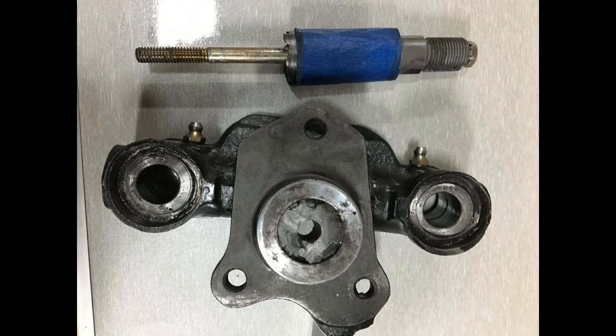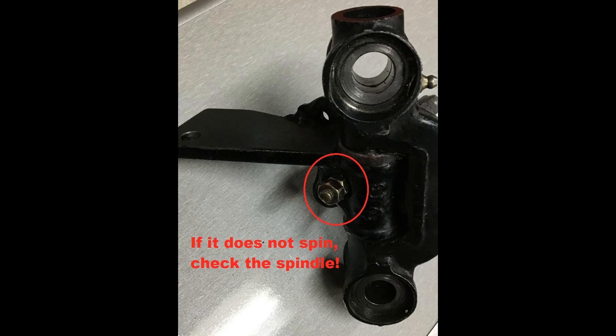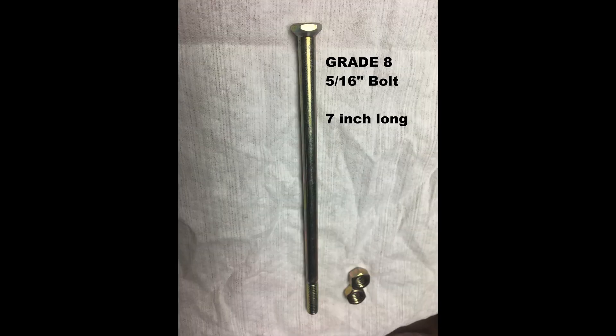There's the speedometer hole where the cable goes through — that's the failure point. On one side it's double-nutted, and you can easily check that between sessions as a quick indicator that something has gone wrong if you can't spin it. The head of the bolt is beveled so that it sits neatly in the bearing adjuster nut and under the cap.